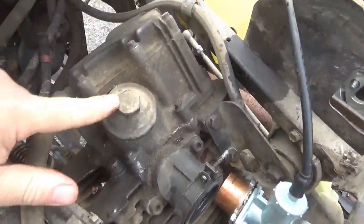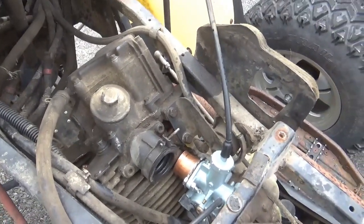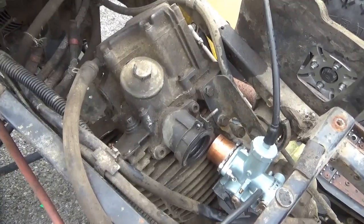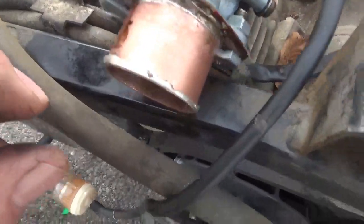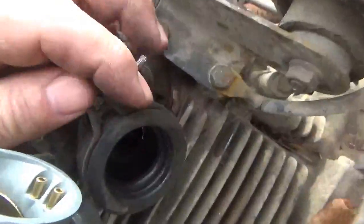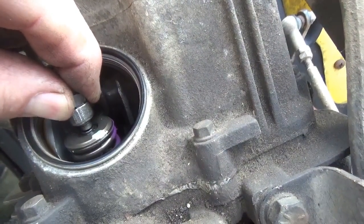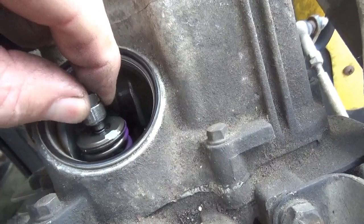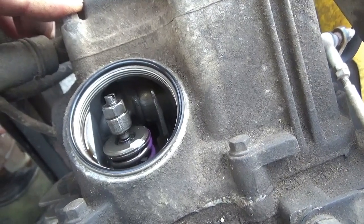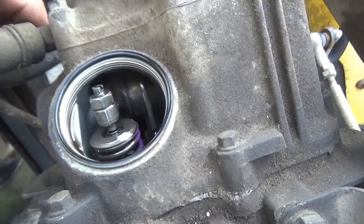I think while I'm here also, I'm going to take a look at the intake valve, make sure it's not too tight. If it's a little tight, it also will bark out the intake and cause trouble, be hard to start, and just be a generalized nuisance. So I put a little ring, there's a couple of wires underneath that solder so that it kind of grabs inside of there a little better. Here's the intake valve, and it's just a tad tight. I'm going to just loosen that up a little bit, so hopefully it'll stop backfiring out the carburetor. If you keep the valve closed, hopefully that'll make things behave a little better.